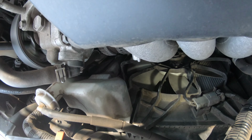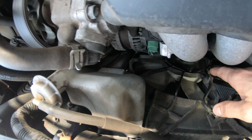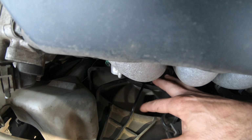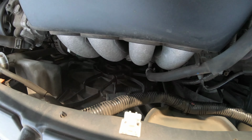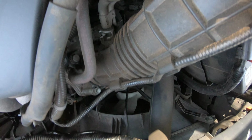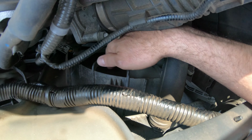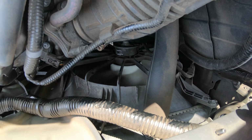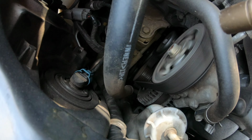I've seen on Hondas, pretty typical that the brushes in the fan motor, oh there it goes, will start to wear out, have bad spots. Let me see if I kind of move it, see it's starting to go. So that motor's getting voltage, just has worn out brushes. Let's see this one. Yeah, there's just bad brushes in the motor, so that's one issue. Just worn out fans.